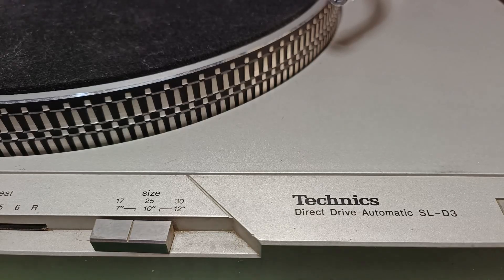Greetings, welcome to my YouTube channel. In today's video, let's talk about the Technics SL-D3. The problem with this unit is it has an off-center pitch adjust for 33 and 45 RPM. If I set the 33 RPM correctly, the strobe is stable, but when I set it to 45, the strobe lines of 45 are very fast — it is off-center. So the center of both 33 and 45 RPM speeds are off-centered.